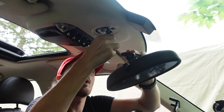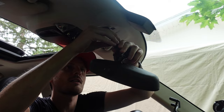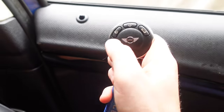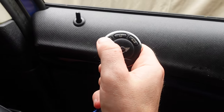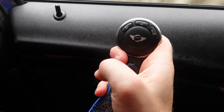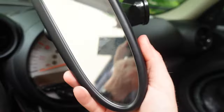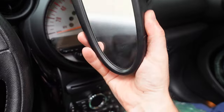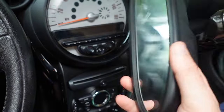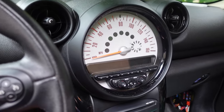We're going to take our plug — it only goes one way, so you can't mess up. Just look at the connectors; they only fit together one way. I'm going to let that dangle for just a second. Here's the key fob — oh, functional! Yes, this car works again! So the issue was all the water that ran through this mirror and waterlogged it. I could probably disassemble it, throw it in some rice, and try to fix it.